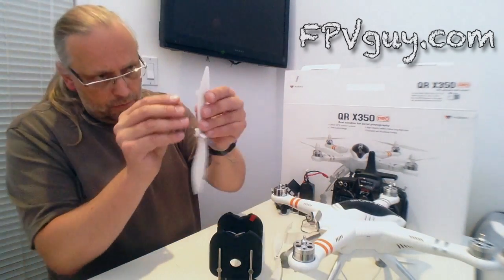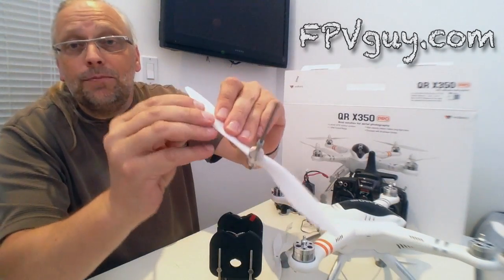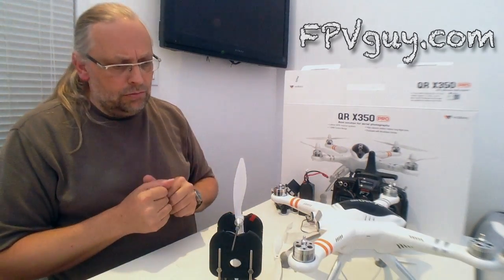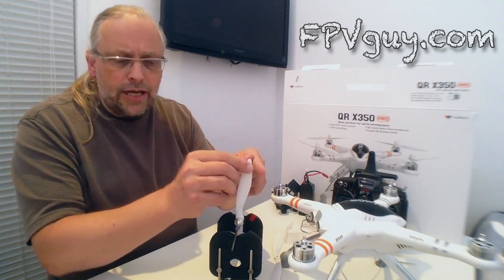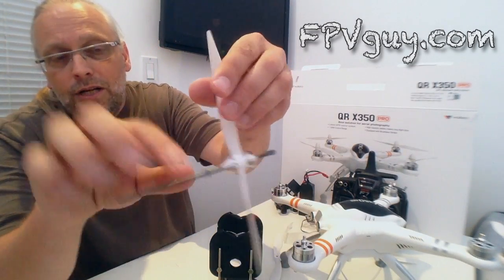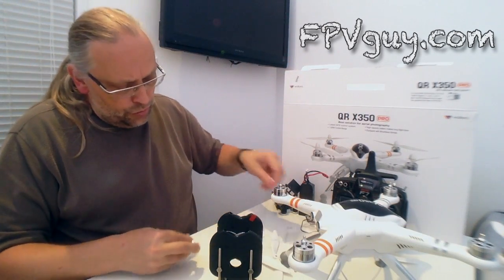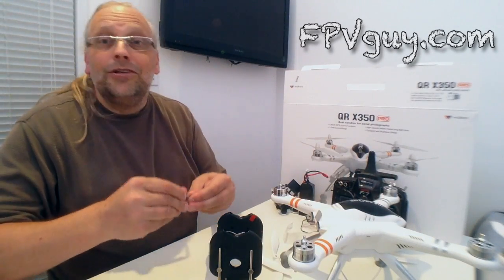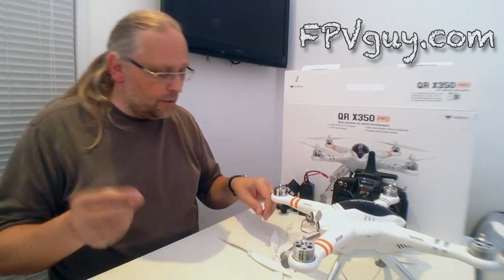I have a little piece of tape — I usually use gaff tape, but you can use whatever you want. Put it about halfway along the blade, see where it's sitting, then try to put it back horizontal. That wasn't enough so we come out a little further. There we go — I wrap it around the front leading edge so it doesn't blow off. I always do the vertical check too. This one is good, so we remove the propeller from the balancer. The DuBro propeller balancer is the standard way of doing this.